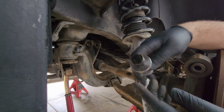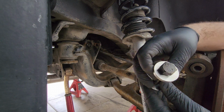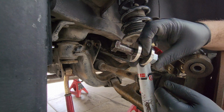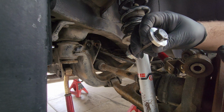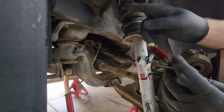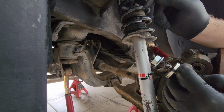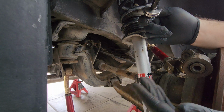As I've said before, I will not be using the eccentric bolts. Any stock eccentric bolts you want to use, you can use them. I won't. I will be using these GK Tech eccentric lockout ones. I will post a link in the description. These are 10.9. They lock out the position, and you can prevent any slippage, any misalignment that you might cause with spirited driving, track days, any performance driving. I recommend these. You can use the old ones if you so desire, but get these if you can.